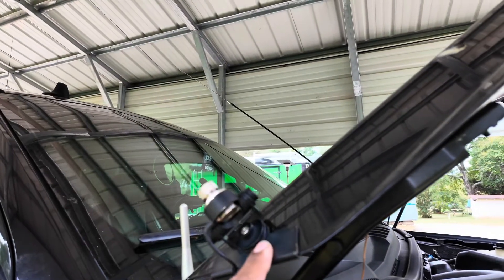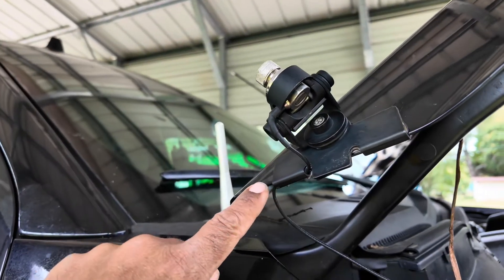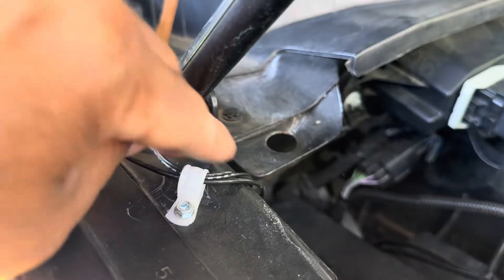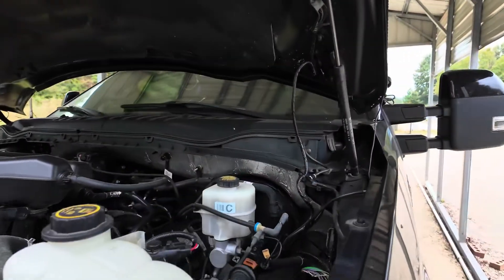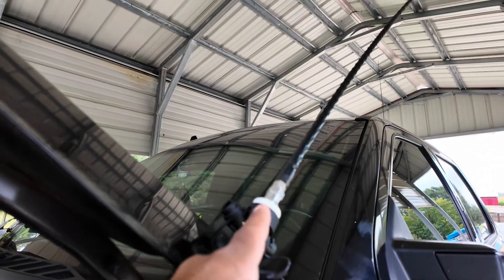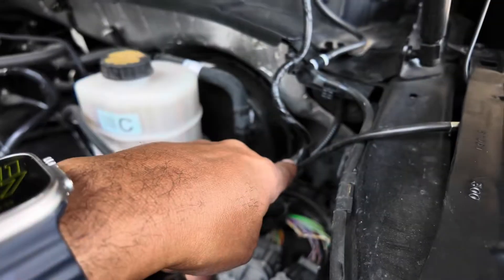I've used, in this case, a Diamond K400 mount. This is where I mount my HF screwdriver antenna, the Diamond SD330. And I route the wires according to practices other people have taught me, and I make sure those wires stay out of the way — clear of the hinges and the high-pressure door lifter. On the other side, there's also a Diamond K400 employed a different way with a hamstick, and I've made sure the wires are clear of the truck and run right down along the front of the firewall.